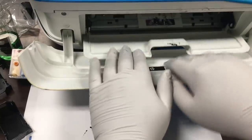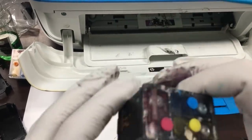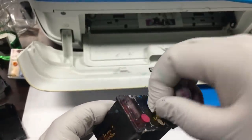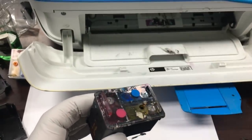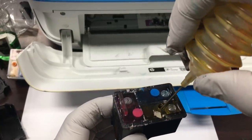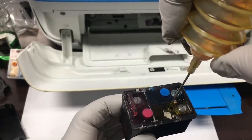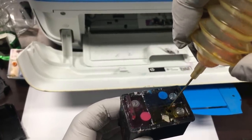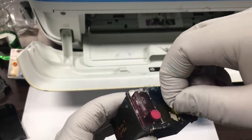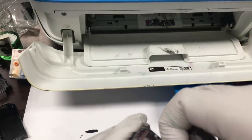Because the ink indicator will not tell us how much ink is in the cartridge from now on — it always shows low ink or ink depleted — we just ignore it and click OK every time the warning shows. After you click OK, the printer will let you keep printing. Keep an eye on the printout and add ink as needed.